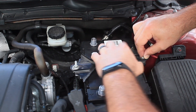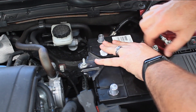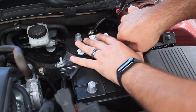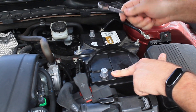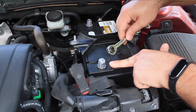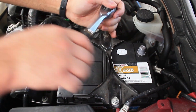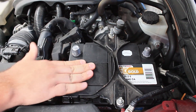It can be a little finicky. Hand-tighten them — and this is important since people sometimes follow instructions to the letter — I'm doing this with the battery disconnected. If you have the positive and negative connected and you're touching ground and accidentally touch the positive, it will arc, and that's going to be a very interesting moment for anybody caught in that situation. So now the battery is tied down and secured — it's not going anywhere.